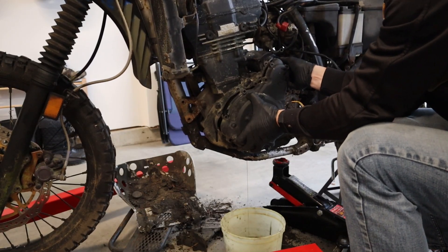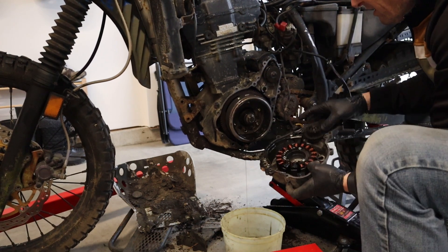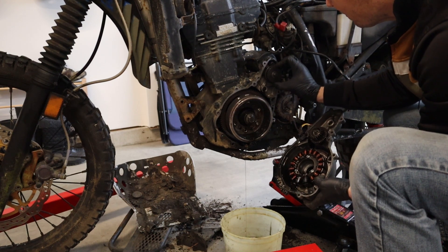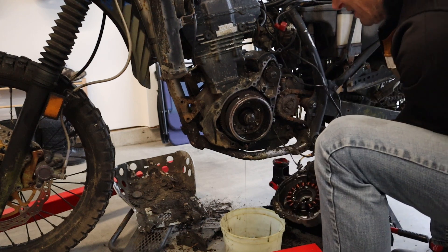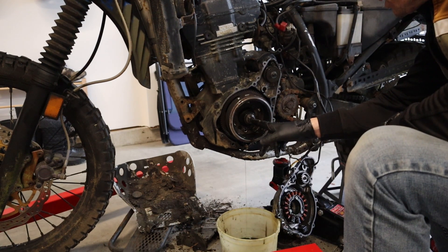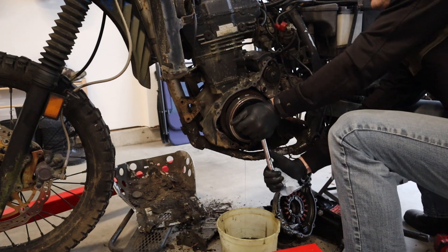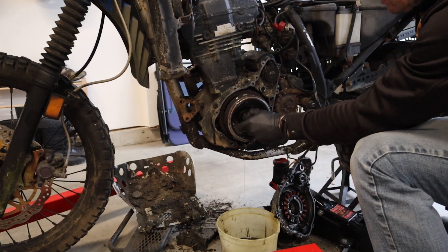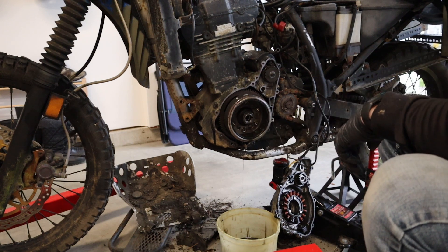It's very magnetic because it's attached to a flywheel. You can see the idler here for the starter. There's your starter, folks - it just comes down, drives this idler, and it drives the gear, and then this thing can just kind of dangle. That is the bolt that we very unsuccessfully tried to turn the engine with the other day. You can see here how seized this thing is. There are some internal threads right here - this is where you would put your flywheel puller. This is tapered, so no matter what we do here, this ain't going to come off just by tapping it.